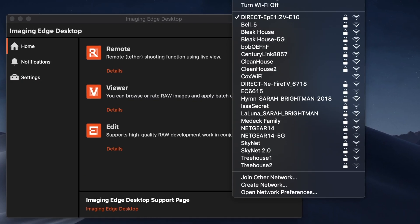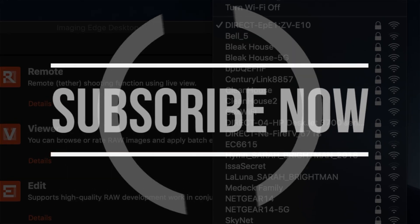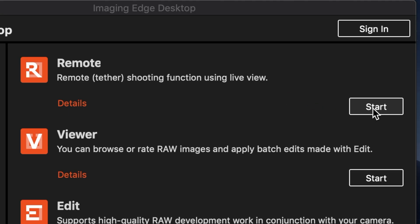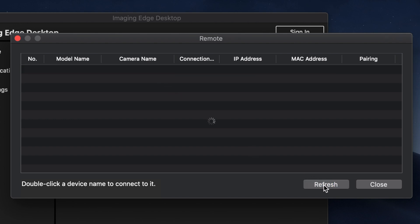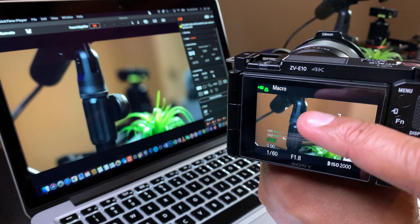What I like to do is double-check to make sure I am connected to my camera. Now that we've got that taken care of, let's open Sony Imaging Edge desktop to see what's going on with our camera wirelessly. You see that little start button on the right — go ahead and push it. Immediately after that, you're going to see your Sony camera appear on the list of compatible cameras you can connect to remotely. If you don't see your camera on this list, you'll have to reconnect to your Wi-Fi. At the very bottom there's also a refresh option to rescan the system. Once you see your camera, click on it once — it'll turn blue — then double-click and it will initiate the process of connecting your camera to Sony Imaging Edge desktop wirelessly.